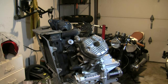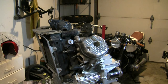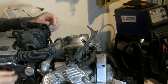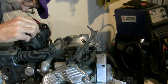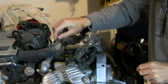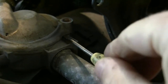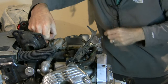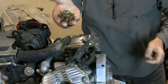Not so much the case with that Suzuki back there — don't get me wrong, I love you, but you have all kinds of different size bolts. With all of that removed I can take this bracket out and clean it up along with the bolts. The top of this housing should pop off; I may have to get a little tool to pry a bit. Right in here I can just get my screwdriver in and pry it up a little bit without doing any damage to the housing. Inside here there is an O-ring which I will have to replace with a new one, and then you can just lift out the thermostat.